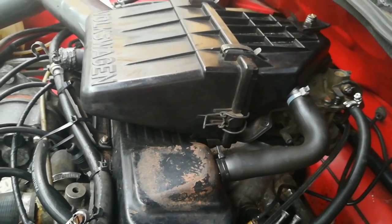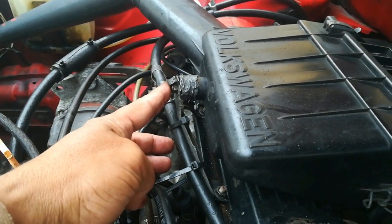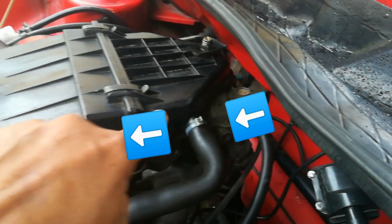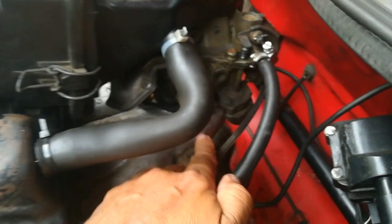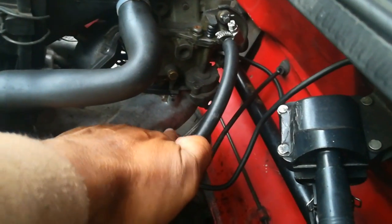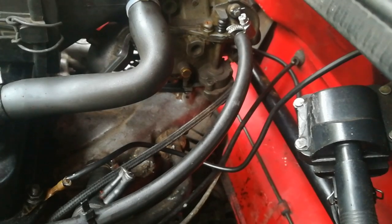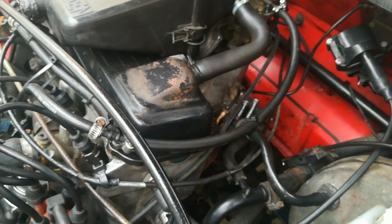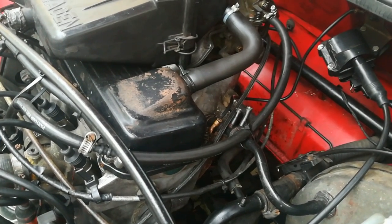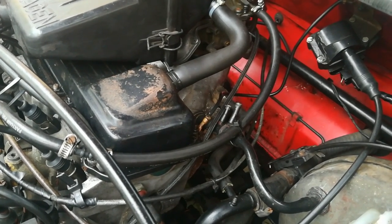After putting on your carburetor and air box, make sure you don't over-tighten this nut here, because if you do you'll be pulling the air box forward, which has an effect on the carb base plate — you'll literally be lifting up the carb, and that can also cause an air leak. There you go — some tips on the carb base plate. Just ensure you put it on very carefully and keep those tips in mind. Thanks for watching.